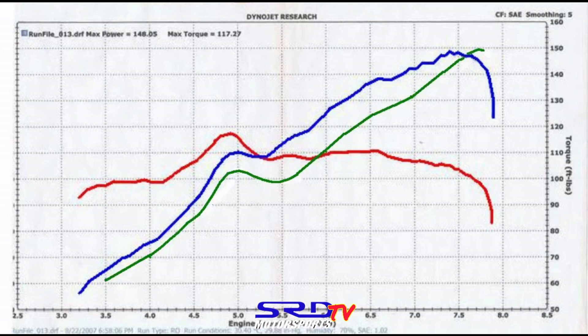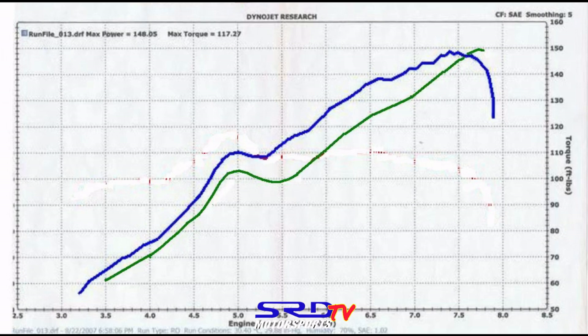It's only at the top end where the VTEC hits 148.97 whp — but at 5,500 RPM the non-VTEC is actually up by 15 wheel horsepower. That's crazy. This is probably why Bong's project, the 148 whp non-VTEC, ran 14.2 seconds on an ESi four-door. To this day people don't really come close to that — and the 14.2 time was with full steel exhaust and Neova tires, no slicks. I removed the torque graph so it's just wheel horsepower differences.